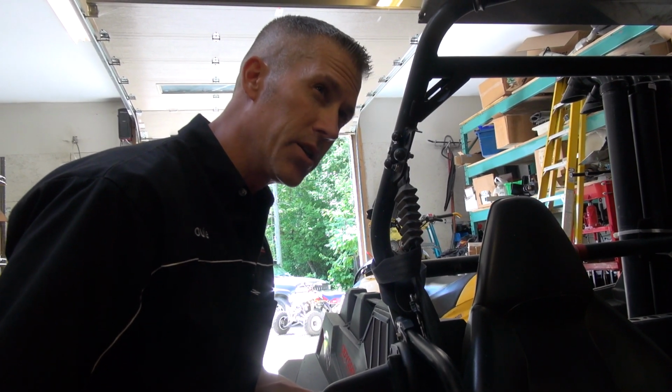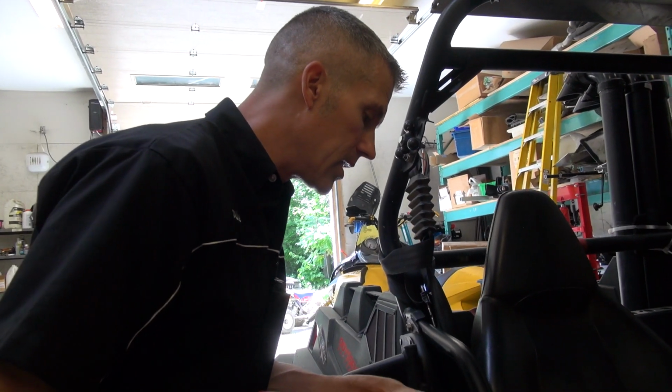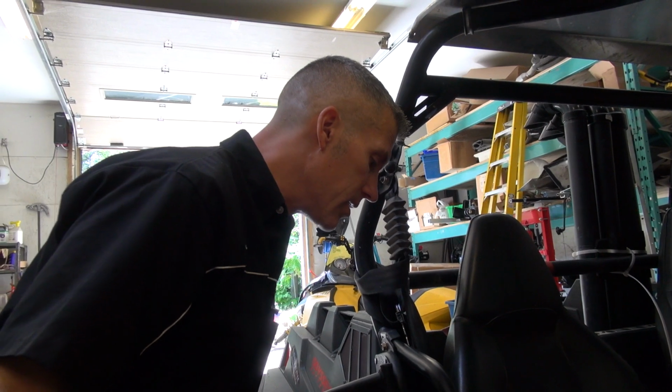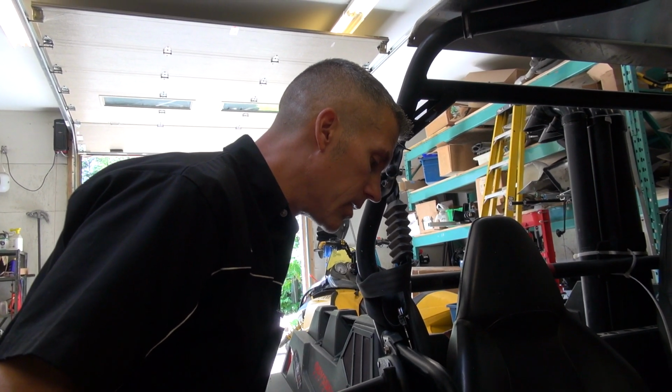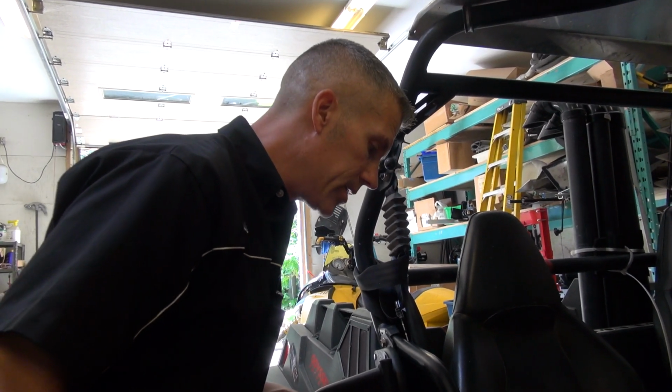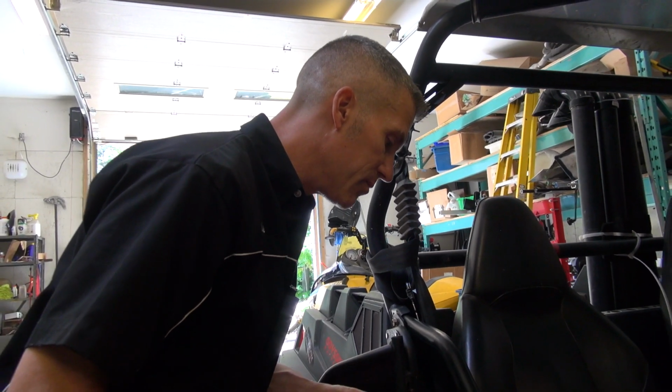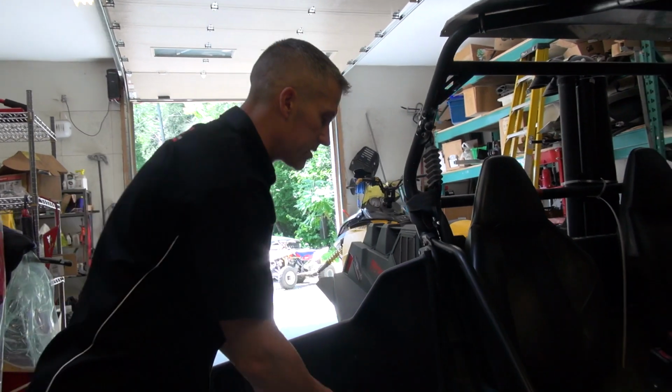I'm gonna change out the belt. I'm gonna adjust the clutching here in a few minutes. I had it clutched for the mud tires with the SLP clutch kit. So I'm gonna take it out and adjust it for these bad boys here so I get the most pleasure out of my driving experience.